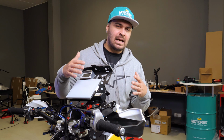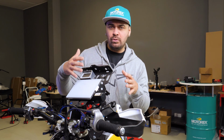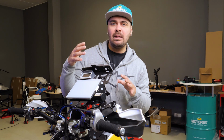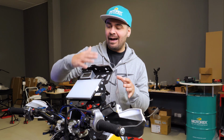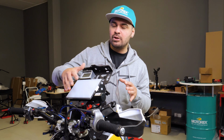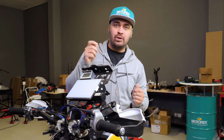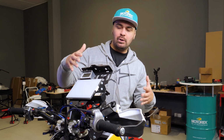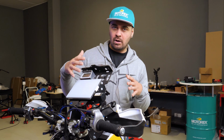This nav tower weighs approximately 2.5 kilograms, so not a lot, but if we compare it to other nav towers that maybe weigh less or have the same weight, the real issue is when you have your instrument and roadbook very high or very far away from the handlebars. Be careful, because this will give you a pendulum effect when you're turning. So on this particular build, I can assure you that anyone that has ridden this bike hardly feels the weight of the instruments on the front end.